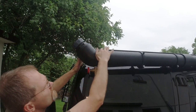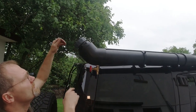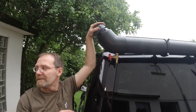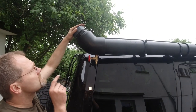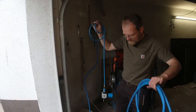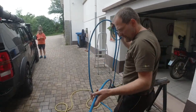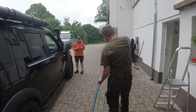It would be all ugly, so we decided to use a 45, and then also a large cap where you can fill it with a, I don't know, what's a gießkanne in English? I put it in writing below. But you can also fill it with a bucket out of a river, in the worst case, without using a funnel. Because I'm now using a permanent supply pressure here with 8 bar out of my shop, I put a regulator in between so we don't destroy anything.